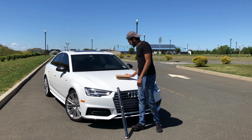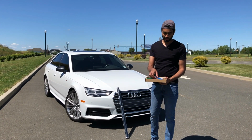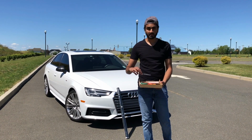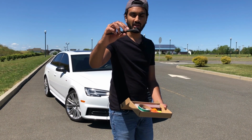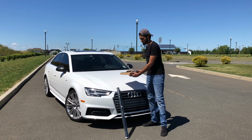So just anticipate errors and keep extra on hand. Now, I highly recommend getting a toolkit like this. This is called a vinyl wrap toolkit. It was about 20 bucks and comes with a whole lot of tools. But if you don't want to spend that much, at the minimum, make sure you've got felt tip squeegees, a razor blade with a bunch of extra blades, and then lastly, try to see if you can get a tool like this. So hopefully you can zoom in, but basically this is called a tucker tool, and it allows you to essentially tuck the vinyl wrap in around very tight corners.